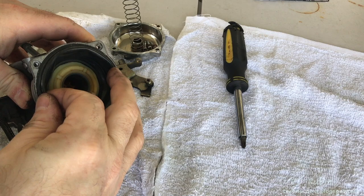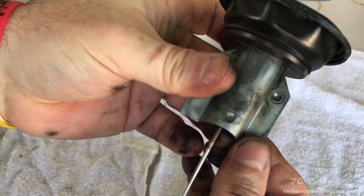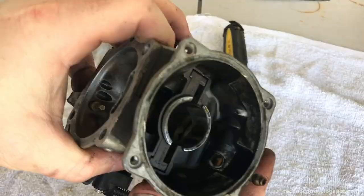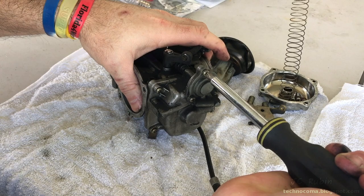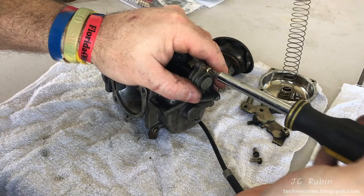The end of the diaphragm is gently pulled out of the carburetor shell, being very careful not to damage anything, then the whole unit is slid out. There's a lot of carbon buildup and soot — more than expected. The needle is fine, but we see a significant amount of carbon buildup on the top side. Moving on to the accelerator pump, removing these three small screws — keep in mind there's a spring behind here as well.